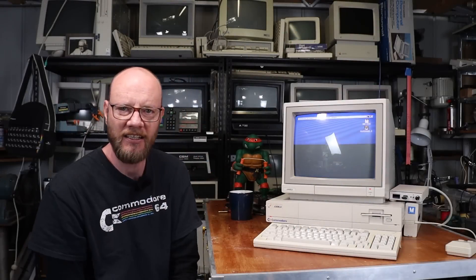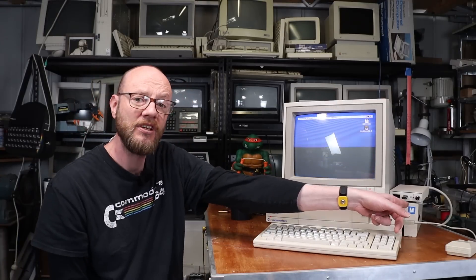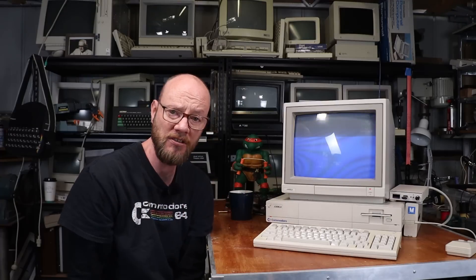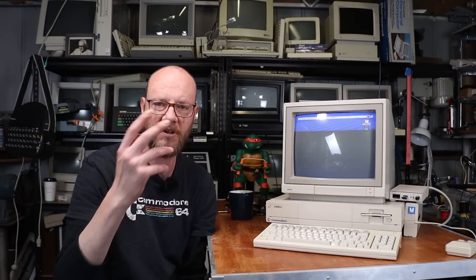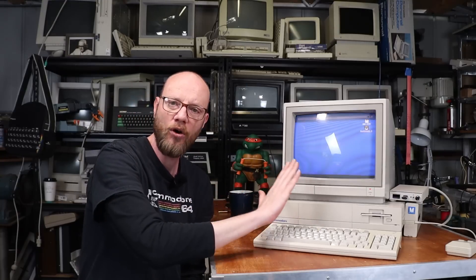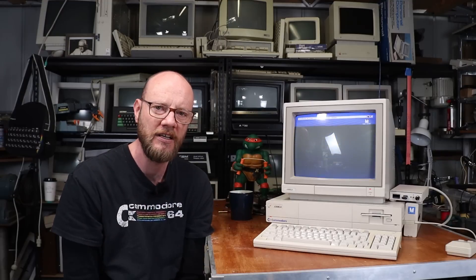And there we go — one very shiny and clean Amiga 1000. With that DF0/DF1 boot switcher added, I can now boot up off the GoTek, which is how it is at the moment. And teamed up with a one megabyte Microbotics RAM expansion — which has got to be the worst sidecar fitting upgrade I've ever dealt with, but don't breathe near it — it's working. Actually quite a capable little machine now. The reason for the GoTek isn't just convenience; these Amiga drives, especially lately, seem to be dropping like flies, so I'll keep the disk drive for when I need to use it. A couple of nice little upgrades for this 1000, but when it comes to upgrades, I think we can do better — and you're going to have to wait for the next video to find out what that is.